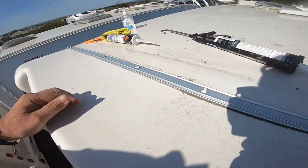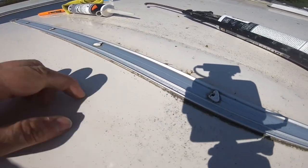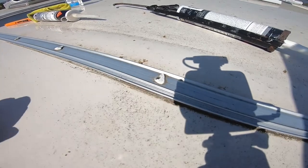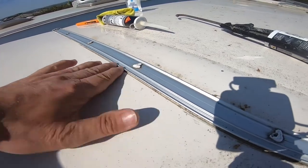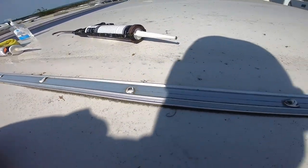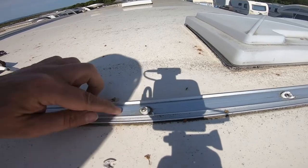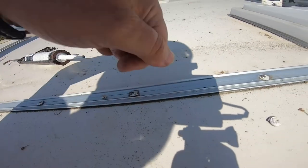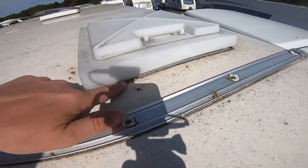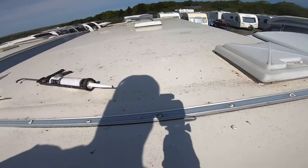So just give it a bit of a scrape. I've done this little bit. When I've cleaned all this off, I'll give it all a clean and bring it back and then just give it a nice little bead all the way along. Make sure the surface is nice and clean so that the sealant sticks. I'm going to give these a little splodge over the top as well — get this old stuff off and go over the top. I might even undo the screws and put a bit of sealant into them. This probably hasn't been done since the caravan was made.